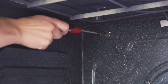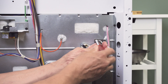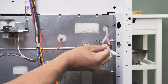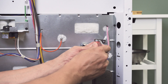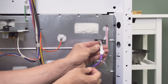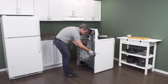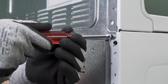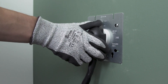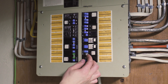Some models will have sensors mounted from inside the oven; other models will be accessed from the back. Simply remove the screw to replace the sensor. Align the new sensor and tighten the screw, then reconnect the wires. Now plug in the cord and push the range back into place. Next, reconnect the power.